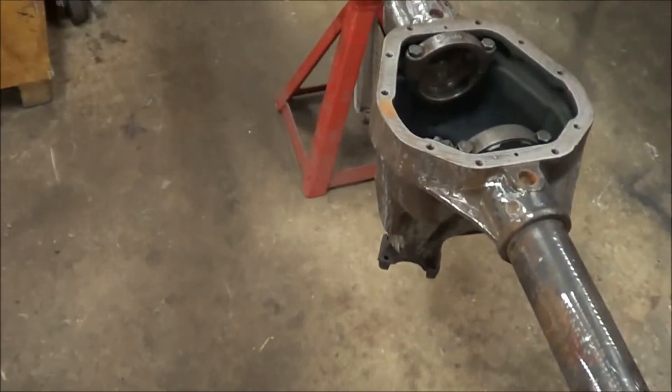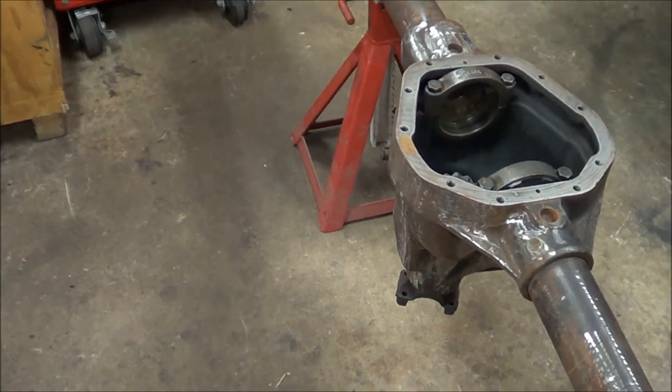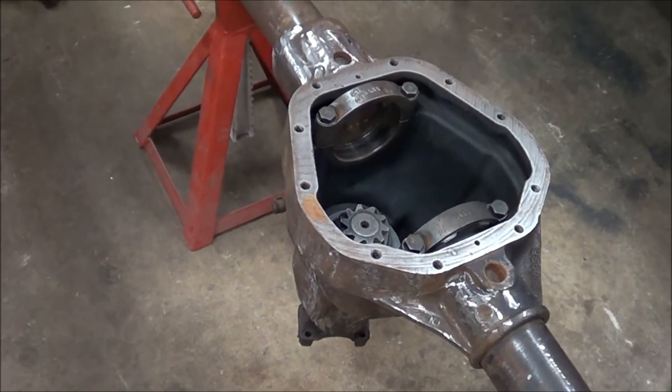The rear I have here is a Dana 60 and I'm basically putting a Detroit locker in here and I'm reusing the original ring and pinion, which pretty much is not really that big of a deal. Normally you can just transfer your bearings and your shims over and you're usually pretty close, but we don't want pretty close — we want this to actually be accurate. So the best way to do this is to use a set of bearings called setup bearings. What a setup bearing does is give you the ability to remove it and put it back onto the diff carrier without the means of a press and pullers, avoiding damage to the bearings and the shims.